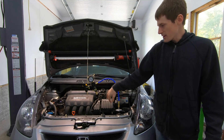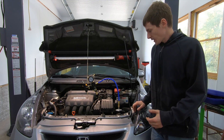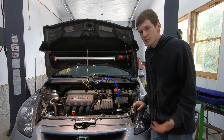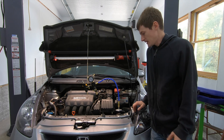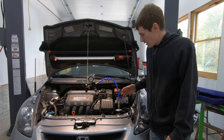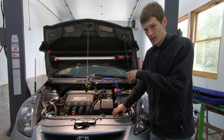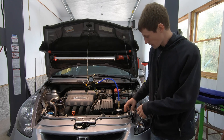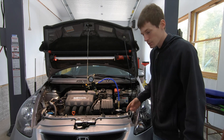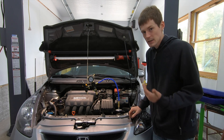While I'm waiting to determine whether it's going to leak - as of right now I'm doing fine - some of you might be asking why you'd ever need a $200 tool to fill coolant. The answer is not all cooling systems are the same. On some cars the fill point for the coolant is actually lower than the highest point in the system. For example, the radiator cap may be three inches below the heater core, so if you try to fill it the normal way with a funnel you can't get the air pocket out of the heater core and you may not have decent heat.